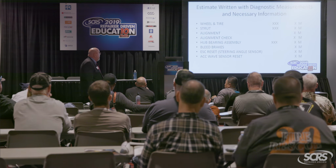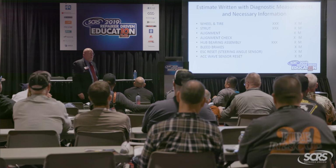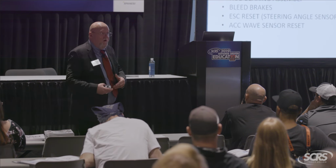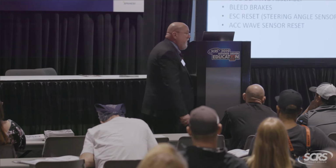What's the definition of alignment? Inspect, measure, and adjust. Now, we did not adjust here, did we? When you come in and you make your adjustments, that's a full alignment. So if you actually ask for 2 alignments, again, you've committed insurance fraud. So you're going to want to do an alignment check, all right? I know we're not supposed to talk about money here, but let's be fair about this. Usually it's going to be a lesser dollar amount than the full-blown alignment because we're not making adjustments. So bear that in mind.